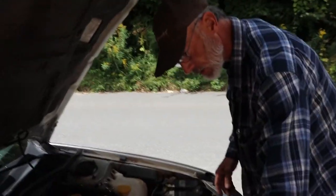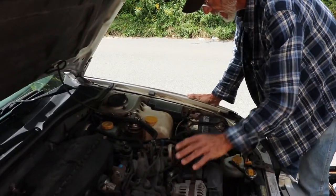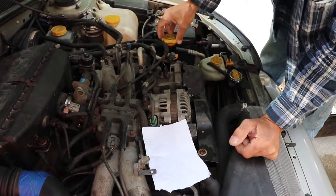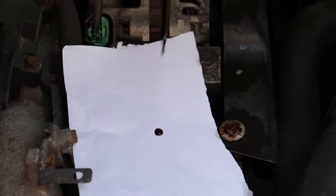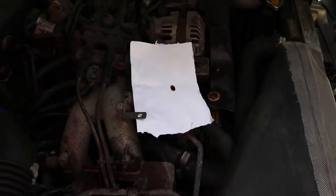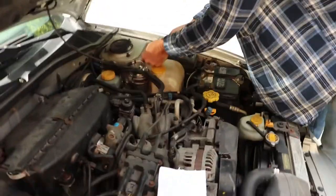The car's been losing about a half a gallon of coolant, probably every two to three hundred miles, best I can guess. We've verified there's no chocolate milk or anything like that inside the oil cap. The oil level itself is good — that oil is gross, extremely overdue for an oil change — but there's no coolant in that oil either. So this coolant is going straight through from the cooling jacket directly into the cylinder and getting burned out the tailpipe. We're going to tear all this down and figure out which side is acting up, starting by taking the windshield washer fluid bottle out.